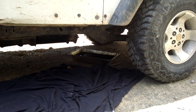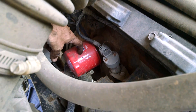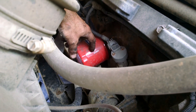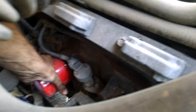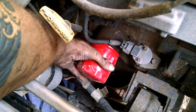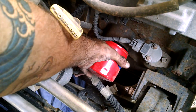Now we have the oil draining — let it drip dry. Come up top here and change the oil filter — that's this right here. You can usually loosen these by hand, but if not you can use a big wrench. You could crush it taking it off but you're putting a new one on, so that's fine. When you put the new one on, it's only hand-tight. This one is nice and appropriate tightness. Below, the oil is still draining.